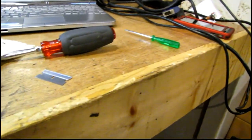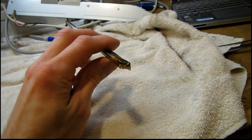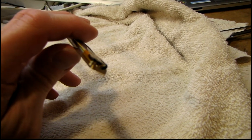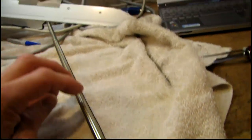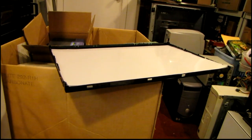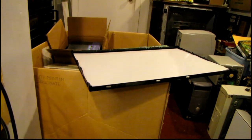Anyway, I had a problem with flickering and hissing and stuff, and I found out after checking it over that it was coming from one of the backlights. It turns out that the wire burned itself off the end of one of the tubes and was just arcing. The bad thing is the screen assembly basically fell apart — there was no way to get the backlights out without taking the screen assembly apart.